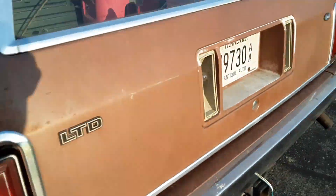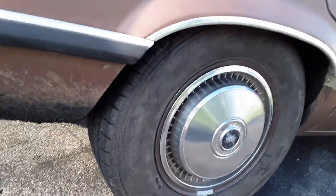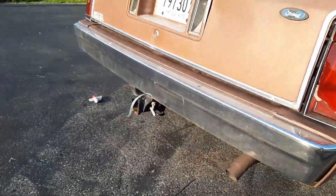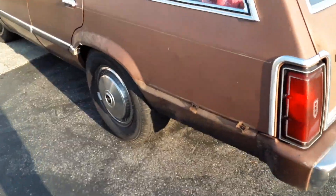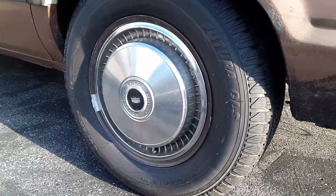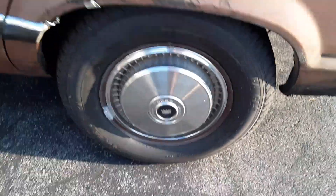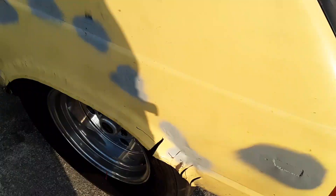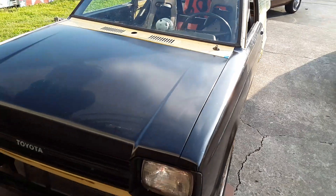They're about 27 by 10 on an 8-inch rim and I really like how they look. I got one at a Coker Tires blemish sale and the other off eBay — one's a Pep Boys tire and one's a BF Goodrich. They should get better traction since they're quite a bit wider; I only had a 235/75 before, which was a really narrow tire. The car's doing great running on E85 and smells better too.